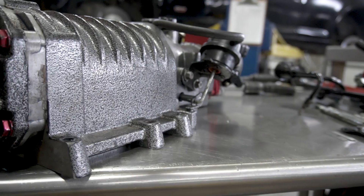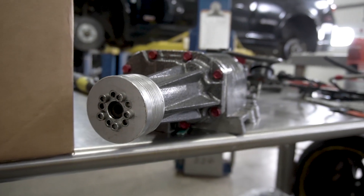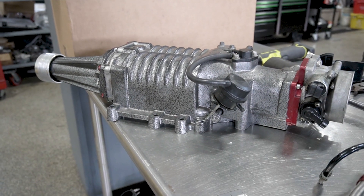For instance, the M90 blower has an efficiency range with and without an intercooler. Without an intercooler, you want to be between six and maybe nine pounds — no more. Putting a smaller pulley in to push up to 13, 14, 15 pounds, you're just blowing hot air and you're over the efficiency range of the blower. It's better to drop pulley sizes to stay in that efficiency range, putting good chargeable air into your engine and making more power.